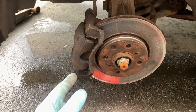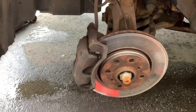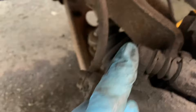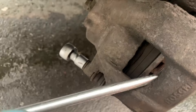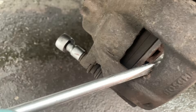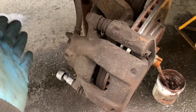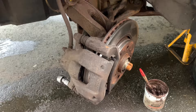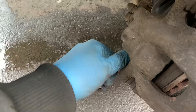I'll change these pads on this side and film this side before it gets dark, then do the same on the other side. I think it's a 12 mil bolt — this one's a 12, that one was a 13 because it's been changed at some point, but it doesn't really matter. Undo this one and take it off. Before I do that though, let's push the piston back nice and gently. Really I should open a bleed nipple so the fluid goes out that way rather than back up into the master cylinder, and at best you should open the bonnet and open the reservoir lid — which I've not done either. Turning the steering helps give you more access.